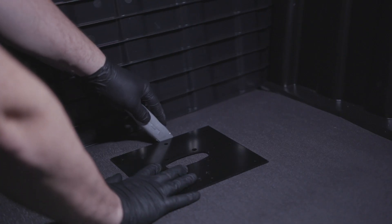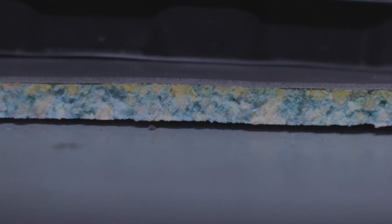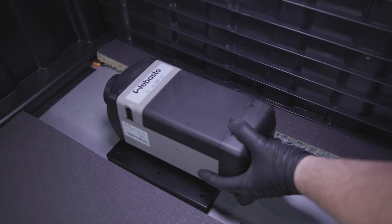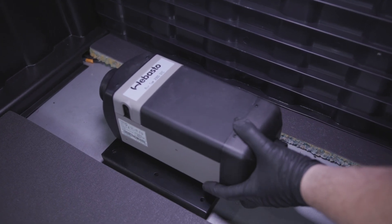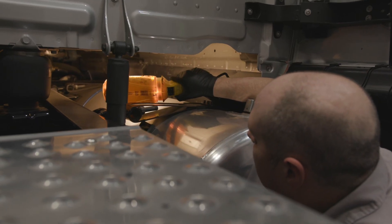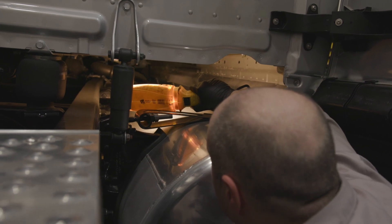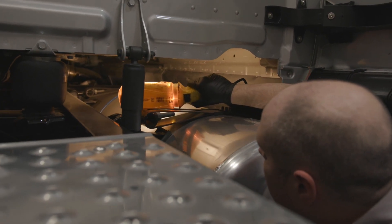To avoid a fire hazard and create a smooth solid surface for the heater, cut the floor out to the subfloor. This also ensures a tight seal and lets the foam act as a spacer to allow proper airflow and clearance for the ducting. Prior to making any cuts, ensure sufficient clearance on the opposite side to avoid cutting into something that shouldn't be cut.